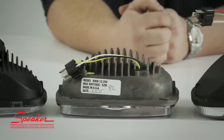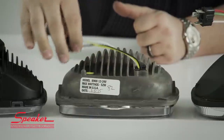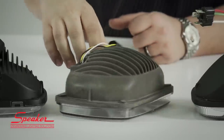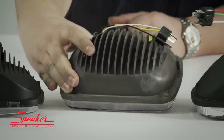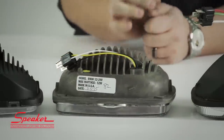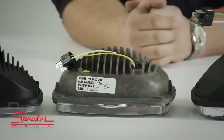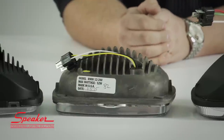That's one reason why the 8900 is considered the best LED 5x7 on the market. You can also see the yellow dot — that is a moisture vent to help keep the inside of the lens nice and clean. JW Speaker does a really nice job with their stickers: they tell you the production date of this exact headlight, the month and year it was manufactured, plus the input voltage, model number, and other pertinent installation information.